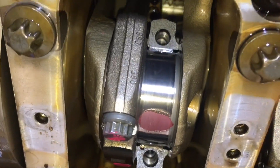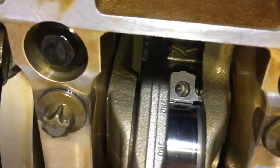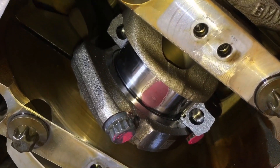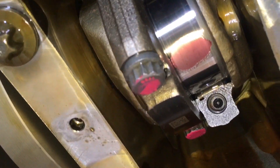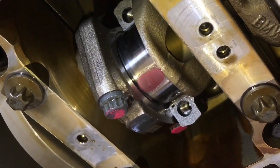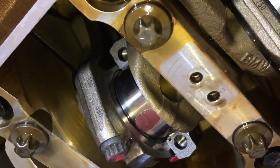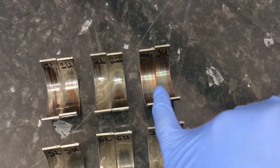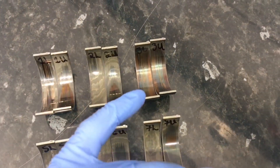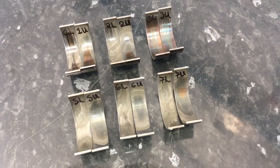The journal looks like it might have survived, so we'll have another look around the back with a mirror. If all is well we can go with that new set of bearings and the owner can be very grateful he got this done just in the nick of time. Well done to the owner for having his con rod bearing shells done as a preventative measure. On this E92 M3, S65 engine, cylinder number three was particularly bad — metal particles visible in the oil around that journal, clearly deformed, and the clearance was very poor at 0.076mm.